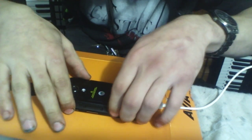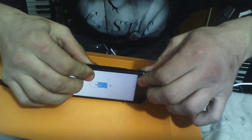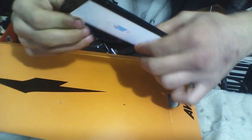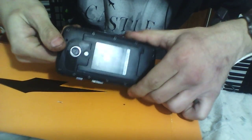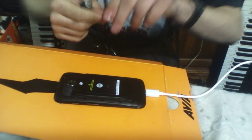Just clip it back together. And then put the screws back in. Oh, yes. But you guys can get that far. Some of the screws on my device have kind of destroyed the threads in the plastic that keeps the screw locked into the plastic case. So I'm going to use super glue to recreate that thread connection.